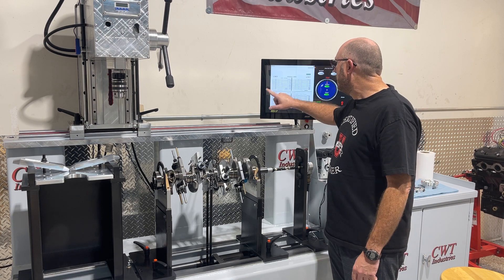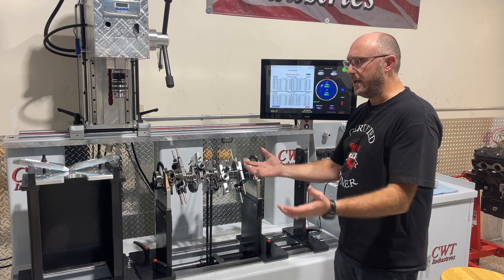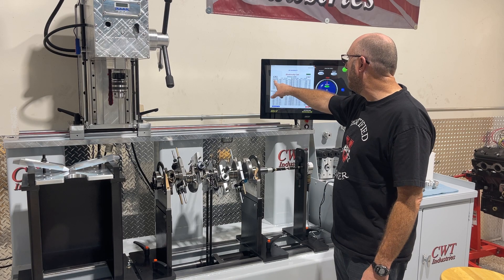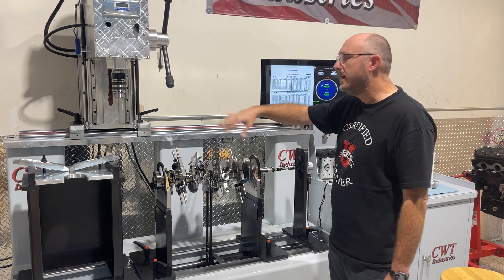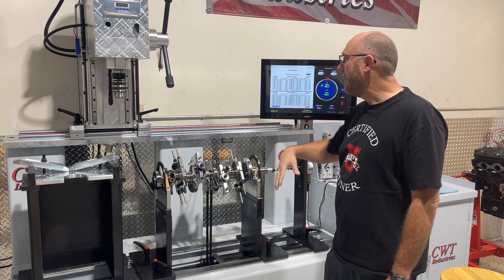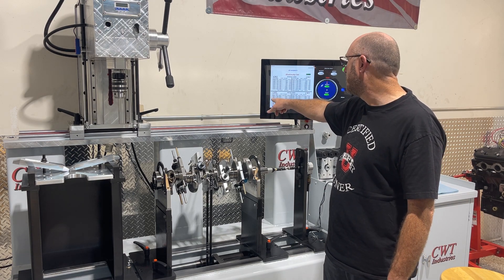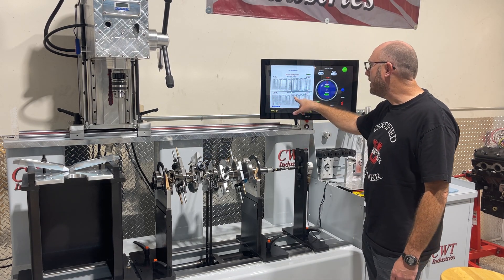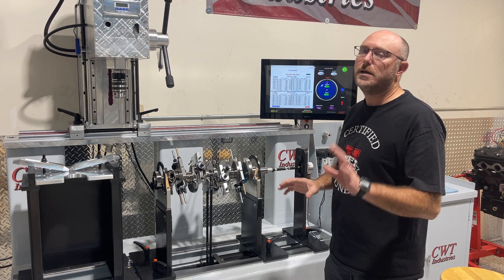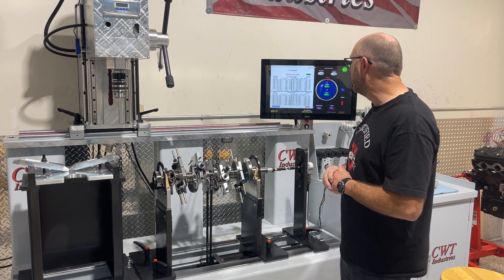So I'm going to hit 'last spin' here and then hit print — this is what's great. Now I get a printout of the amount of unbalance that I have. If I just set the crank statically, it's pretty fixed. So at 1,000 RPM, I had about 1.185 on the left side and 6.675 on the right side when we first spun it. I've been able to reduce that — it pretty much stayed the same on the left at 1.083, but now the right is all the way down to 1.082. So I went from almost 7 grams of imbalance — and in fairness, that's nothing in the real world — but I brought that all the way down to just above one gram of imbalance.